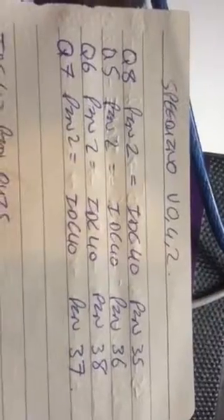Sorry for the long video, but that is the point I've been trying to make. The pinouts I'm showing you are 100% physically correct — you can beep them out yourself — but in practice they don't function that way. The schematic pinout assignments do not match the actual functional behavior of the board.